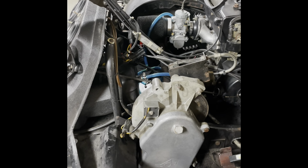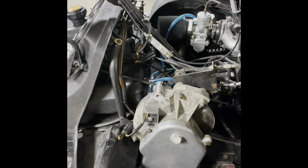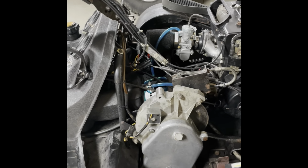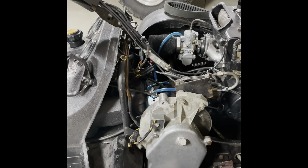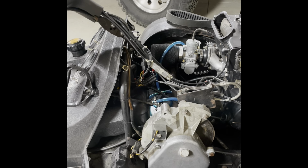Yeah. So this doesn't have a chain adjuster on it, but newer versions of sleds do, like the ZRTs, they got those chain adjusters, and this thing's tension seemed good on it, but yeah, pay attention if your chain's worn out. When I looked over this thing, it seemed good. The links and everything seemed decent, even though it was shimmed a little wrong. I was kind of maybe concerned the chain might have got a little tweak, but it seemed good.